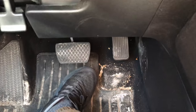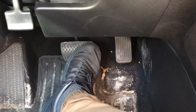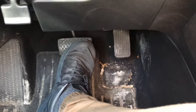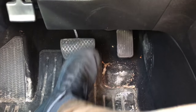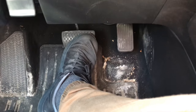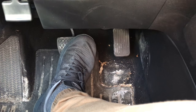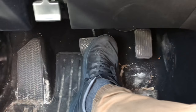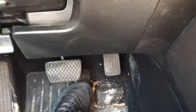There are many different reasons for your brake pedal to be hard or stiff to press down. In my case the brake pedal is perfectly fine, but if you're in a situation where your brake pedal is difficult to press down and you're trying to figure out why, you should look into whether or not it might be the brake booster. If you do this test and once you start the car the brake pedal is able to be pressed down the remainder of the way, then it's a good indication that your brake booster is perfectly fine and you can rule that out and move on.